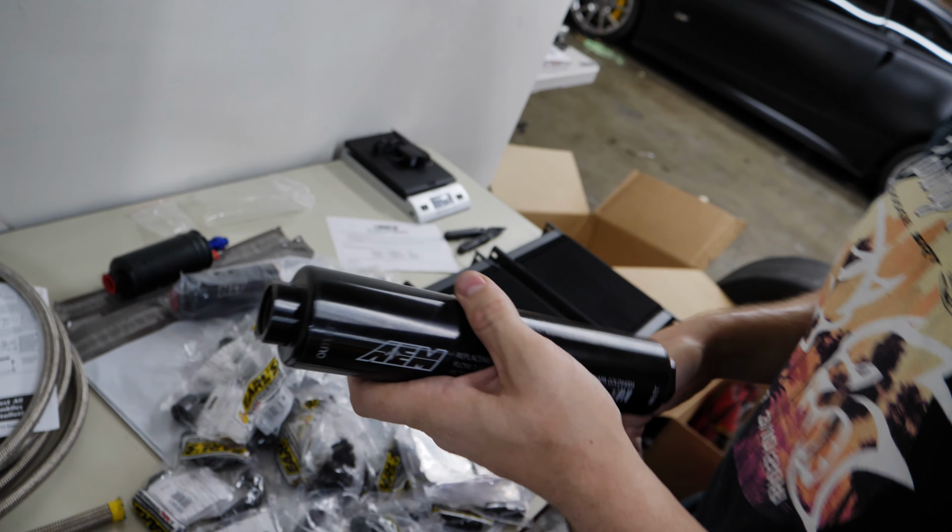That took way too much brain power to try and solve while maintaining as much of the car as possible, but then finding where the limitations are, because we're gonna be running E85, so it's not just about maintaining a certain level of pressure, but the amount of flow is nuts. It's 30% more for the same horsepower.